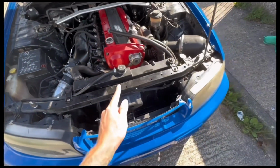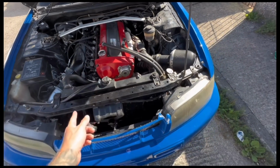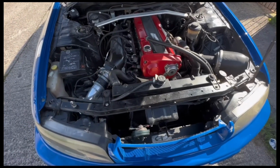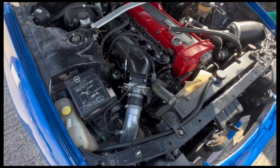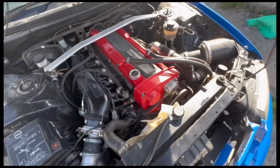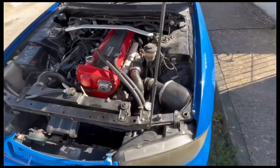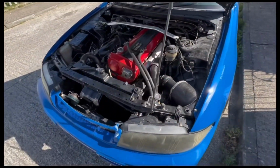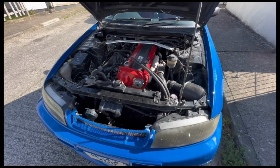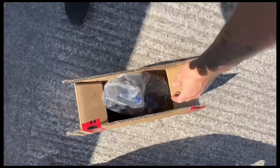And we've only got water in the radiator at the moment, so I've got coolant, I've got new hoses, so I might as well do it all in one go, drop all the water out, and swap as many hoses as I can get to from here, maybe underneath, do the bottom radiator hose and the top one at least, and whatever else we can change. I'll show you the kit and link it in the description if you want to get hold of it. It's only like 70, 80 quid for a silicone coolant hose kit. I think it's straight from China, so should be alright though. Okay, here's what we got.